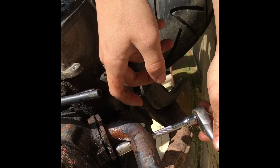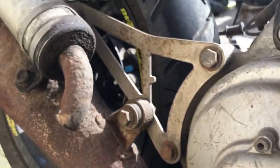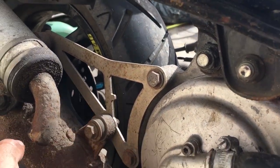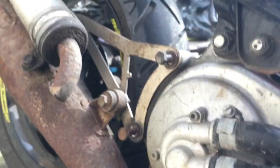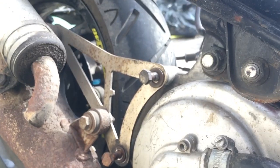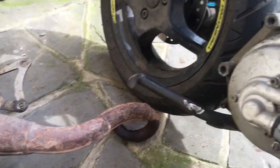The exhaust is now released — there's a bigger gap and it's coming loose. Come over to the other side where the exhaust exits. I'm running a Yasuni exhaust. For the bracket over by the water pump housing you have one bolt here and one bolt here — 13 mil. I've got those two bolts out; they did need a little pull because they were really solid. Once you pull these bolts out the whole exhaust is just going to drop, and the exhaust has come off just fine.